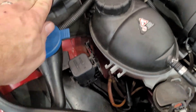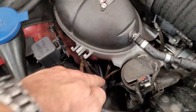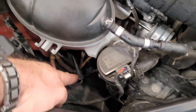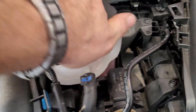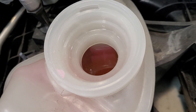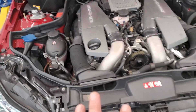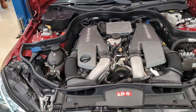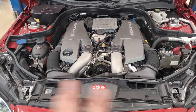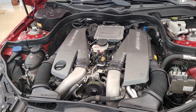Here's the finished product with the tank reinstalled — looks completely factory, and the fuse is accessible. To remove it you can either pull the wire hard or just take the fuse out. To verify it's working, turn the car to the on position without starting it — you can actually hear the pump working. Pop the cap and you can see the water is circulating. The pump, which is way down there, you can actually hear and feel that it's on. This will continually circulate the fluid so we always have fresh cool fluid instead of that inconsistent hot-cold cycle.